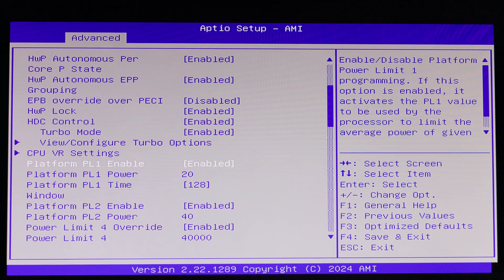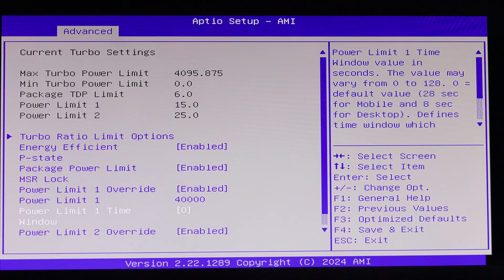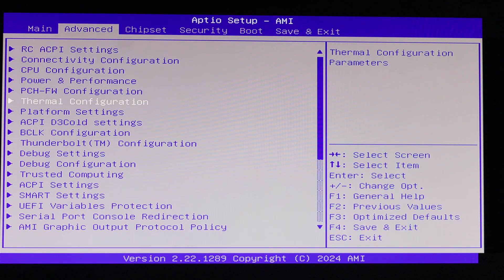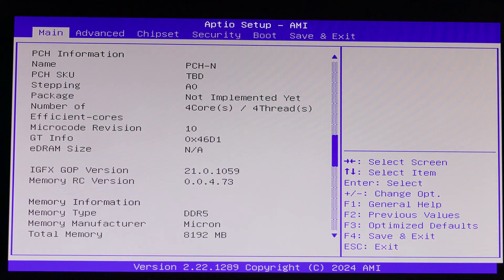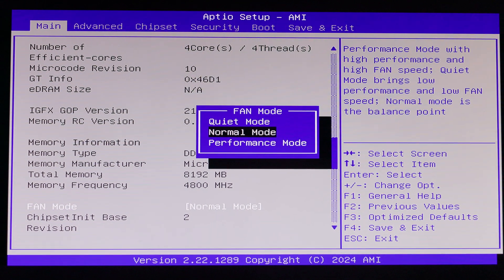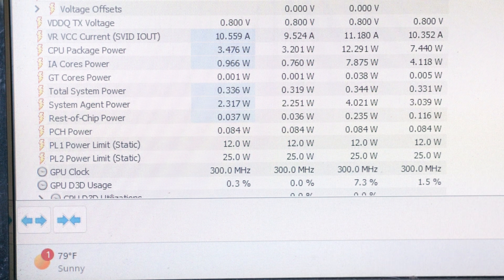My first thought was to turn up the power limits to let the clocks get a little higher during sustained loads, as there's quite a bit of thermal headroom. So I went into the BIOS and tweaked the PL1 and PL2 settings. This BIOS has every option enabled, which I normally think is a good thing, but here it's kind of confusing. There are multiple PL1 and PL2 settings, and some options that seem related to a laptop battery, suggesting the BIOS may have been designed for a laptop platform as well. I asked their support how to configure the power limits, and they said it's under fan control on the first page — quiet mode gives a 12-watt PL1, the default is 15 watts, and the high-performance mode gives 20 watts. I went and adjusted those settings and it did change performance a little bit.